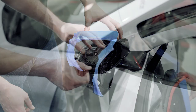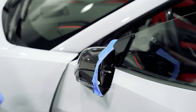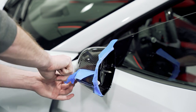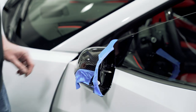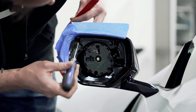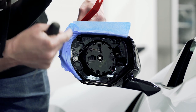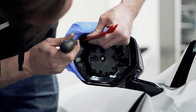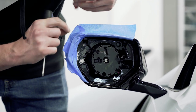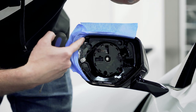Next we need to remove the outer mirror cap. Place a little bit of tape along the seam, as we do need to stick a pry tool in here to release a clip at the bottom. After taping, tuck the tape under the mirror cap. We're going to start on the front side and release some clips there — beginning with the outboard clip. There is a small tab that we need to pry down as well as a little box that sticks down that we need to push back on. Use a plastic pry tool to pry down on that, then using your flathead screwdriver push back on that plastic box to release the mirror cap. Sometimes you have to release the inboard one first and then come back to the outboard one.